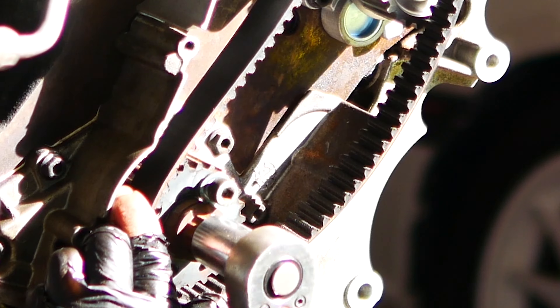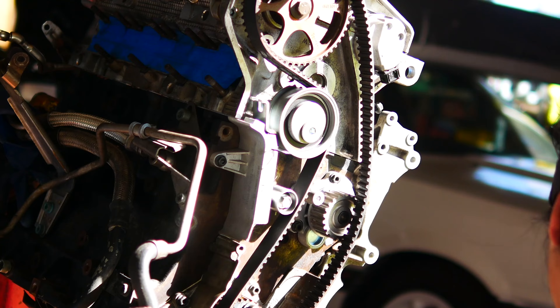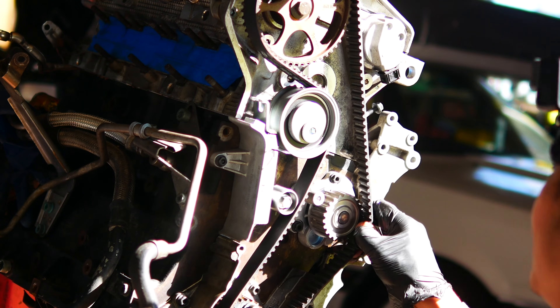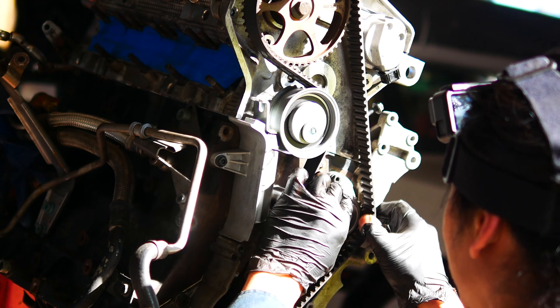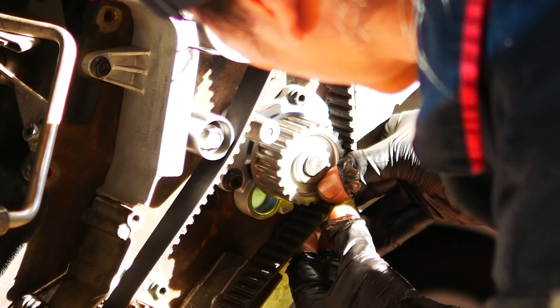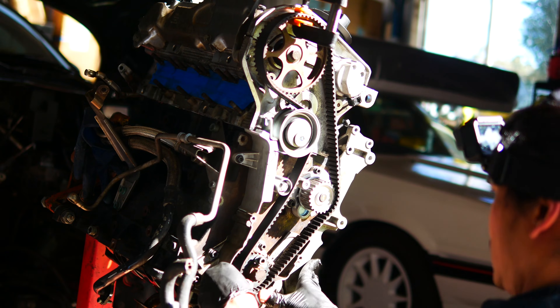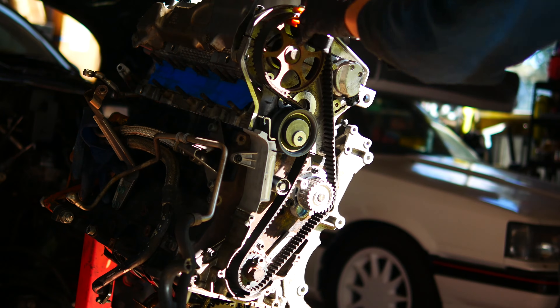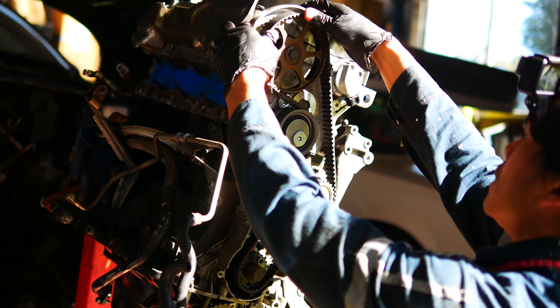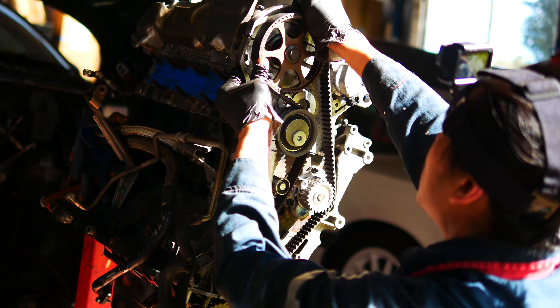To give some slack at the water pump side of the belt, I turned the crank counter-clockwise slightly. You can see it gives more slack to the right side of the belt, and this is where it takes some fiddling of the water pump sprocket to get the teeth aligned and then the belt should push on. Once on, start pressing it all the way in so it's got full contact to the sprockets. You might also need to go around in an even manner to get the belt fully on.